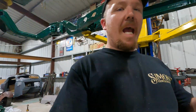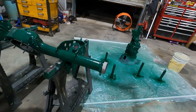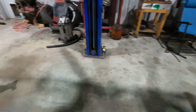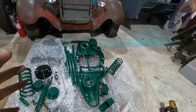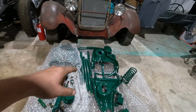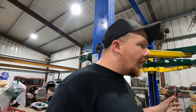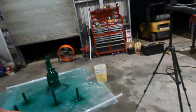Okay, now that we got paint on the transmission and stuff, like I said, I'm gonna powder coat the bell housing. I was just worried about the transmission and the 4 hydraulic cylinders. I got the rear end. We'll go ahead and hang the rear end in here. We're gonna have to drop it back down though to put the rams and the springs in the rear. And then we'll work on getting the front control arms, wherever the uppers are. Oh, over there. We'll work on getting those. Get the bushings in them, get those in there, and then there's like a support thing in there and pedals and stuff. You know, everything you need to put a car together. One thing I did not take into consideration is that I painted this stuff right where I need to work. So it is what it is.